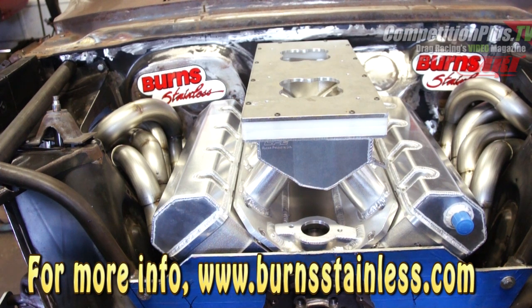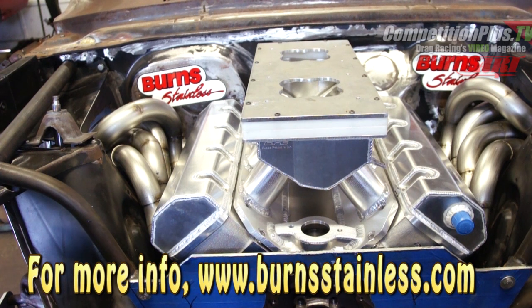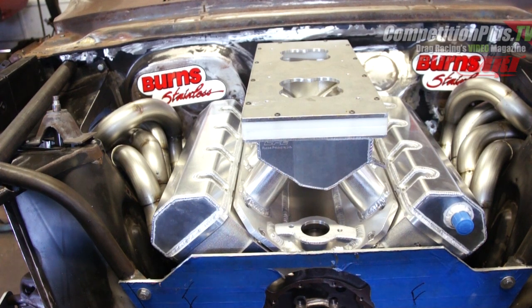You really ultimately need to go with a set of fender well headers on this because the cylinder head on the SB2 motor is so much wider than a conventional wedge head motor. It pushes the exhaust port out even further, which means you run out of room. The motor is up as high as we can possibly go and as far back as we can legally go, but we're able to build a header design that works correctly with this application.